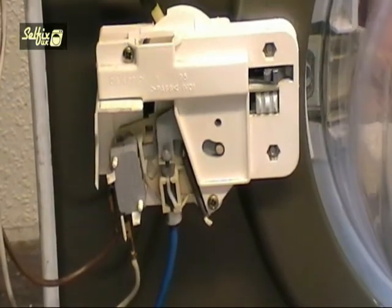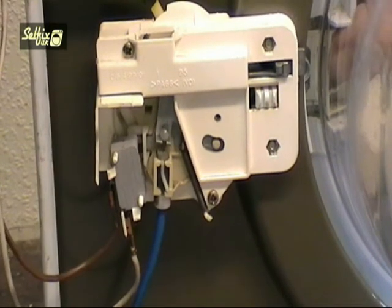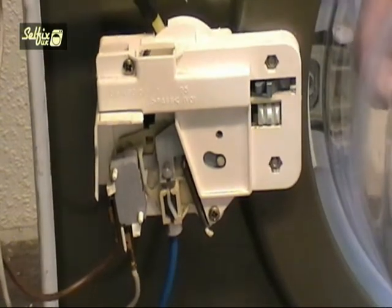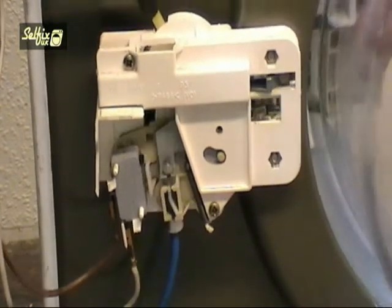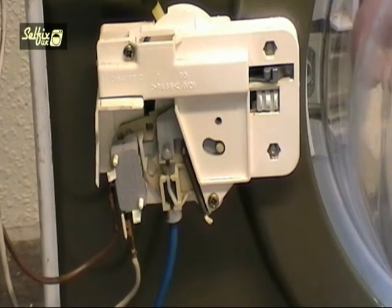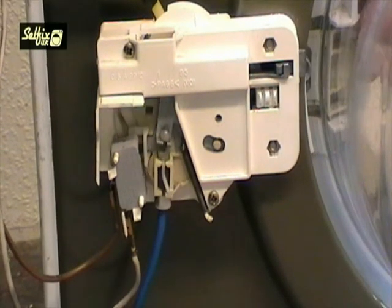As you can see here, when the door handle is operated, the latch lever pulls a slide mechanism across the interlock, which in turn lifts an arm connected to a cable. The outer casing of the cable is attached to another part of the interlock which holds the latch in place. When the whole assembly is pulled up like this, it releases the latch and the door will open.